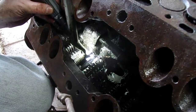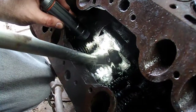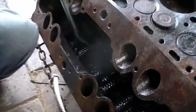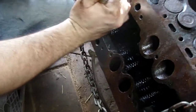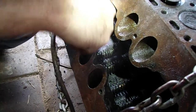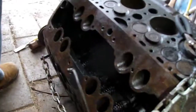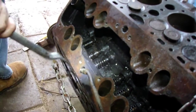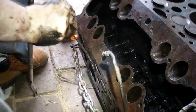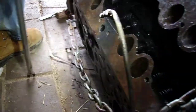There are little keepers in there. You push that part up and you can pull the keepers out, then it slides all the way down to the lifter like it is right here. That's what we've done — this is our first time, so there's probably better ways to do this. We just need to pry the valve up a little bit. This valve is so stuck in there that I don't think we're going to be able to salvage it. We're not going to reuse this valve because it's seized so badly. If we can't get it out, we'll just break the head off.